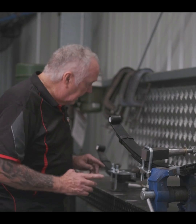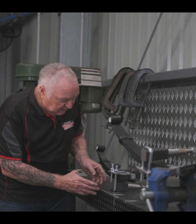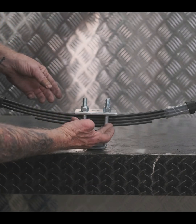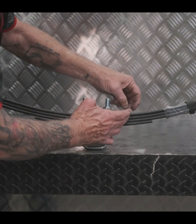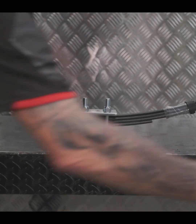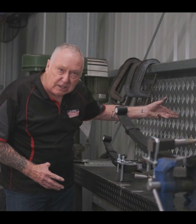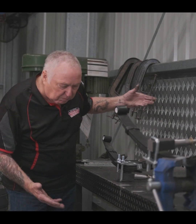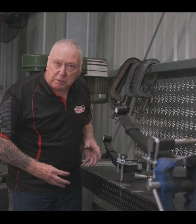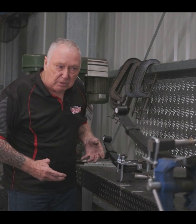Now, with an under-slung axle, the issue for me, in my experience, is that if the U-bolt breaks, or a part of the spring breaks, or something comes loose, the axle's got nowhere to go but out. It will be held perhaps on one side, and so you've got this axle on one side dragging backward and forwards, creating all sorts of problems on the road — perhaps coming off and maiming or hurting somebody.